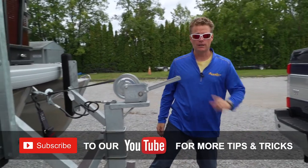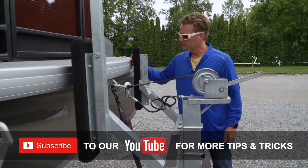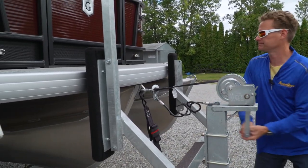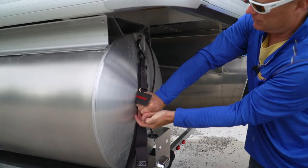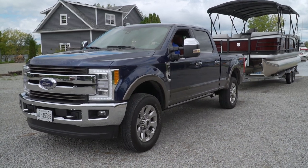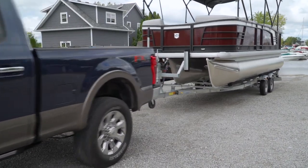Now, before we leave, we want to make sure the boat is all the way on the trailer, because that can affect the load balance. We've got a little gap, but our bunks are wet, so it should just winch all the way on. All that is left is to secure the fenders and lines, tie down the boat at all corners, and hook the lights back up. Depending on how far you need to trailer, it's not a bad idea to stow the bimini so the wind doesn't damage it at higher speeds.